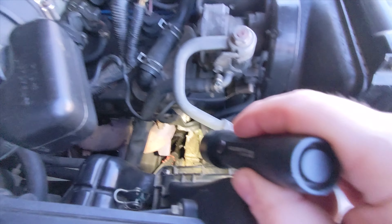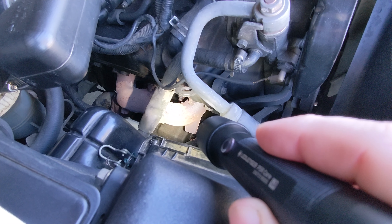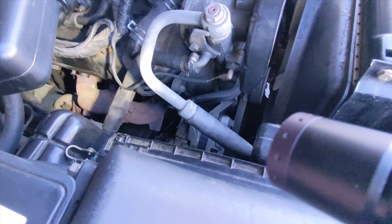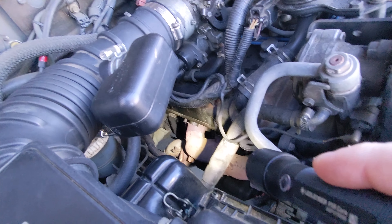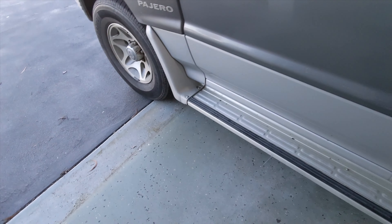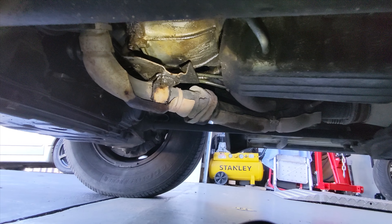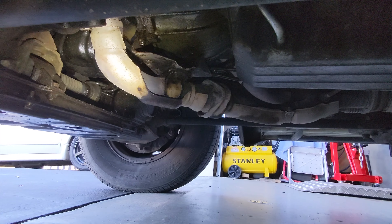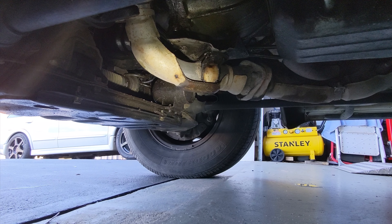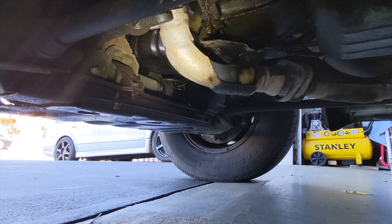Yeah, look down there on the alternator mount. I'm pretty sure there's a crack in that manifold, but I'm going to get some high-temp permaseal and just wick it into the gap and see if that fixes it. This is a beater for the family — I don't really care. Worst case, I could grab one from Jolly's, the local wreckers. You can see everything is wet. Let me dive under it here and show you. I'm pretty sure we could have a sump gasket failure — no big deal. These are pennies in the dollar compared to thousand-dollar fixes.